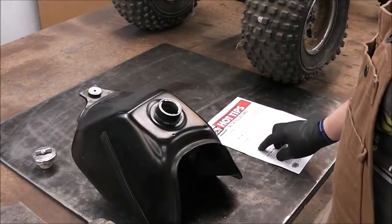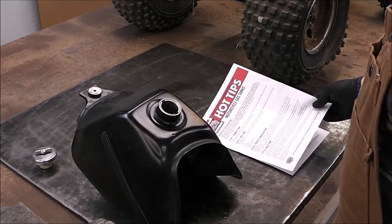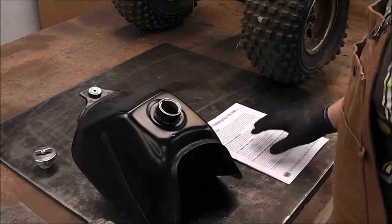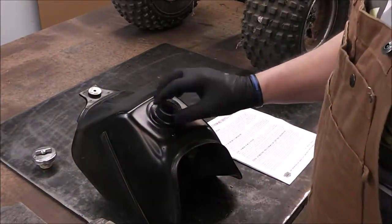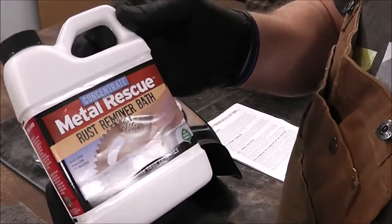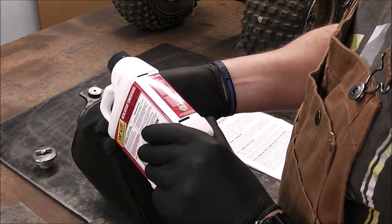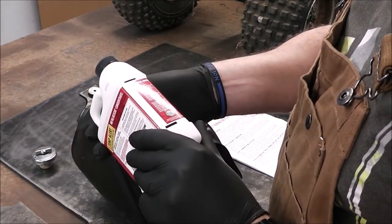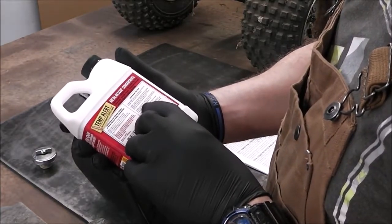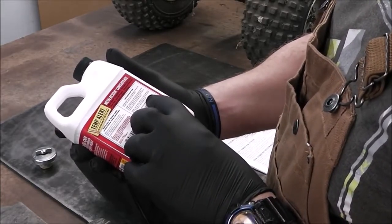Next step — we've taken all the loose and flaky stuff out of it. It's safe on chrome, rubber seals, gaskets, and O-rings. Wash the tank to get out any stuff and add the solution to the tank. They say it's best to fill it all the way to the top so you can fully submerge everything. It says add it to one gallon of water. Soak times vary: light rust up to 2 hours, moderate rust up to 12 hours, heavy rust up to 48 hours.